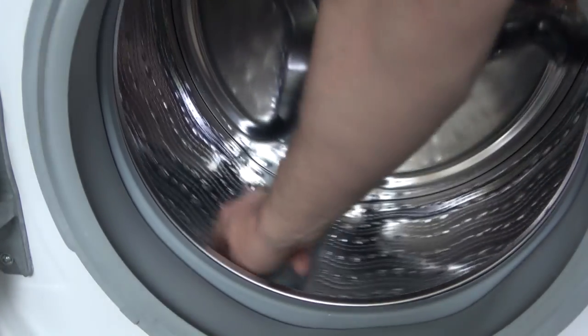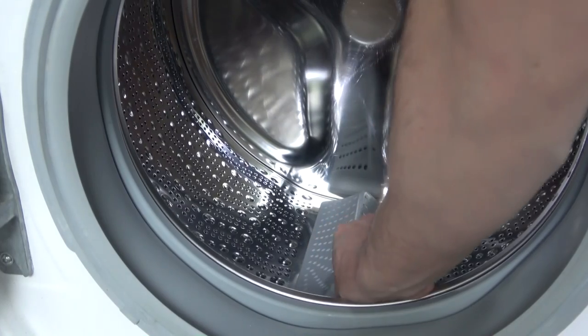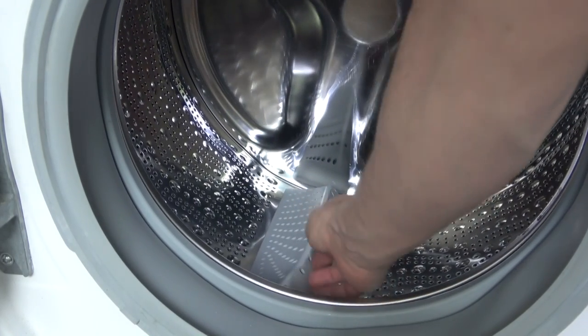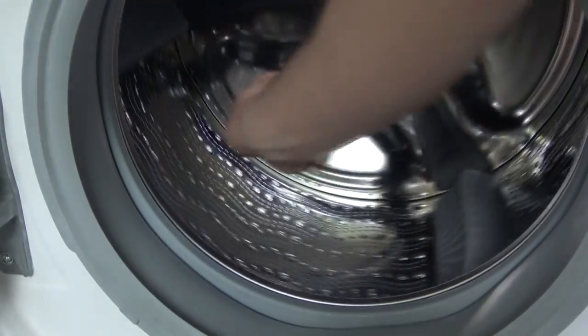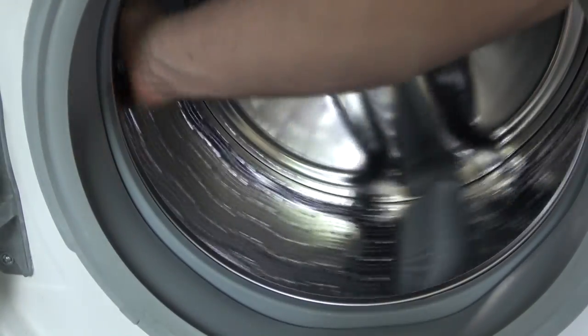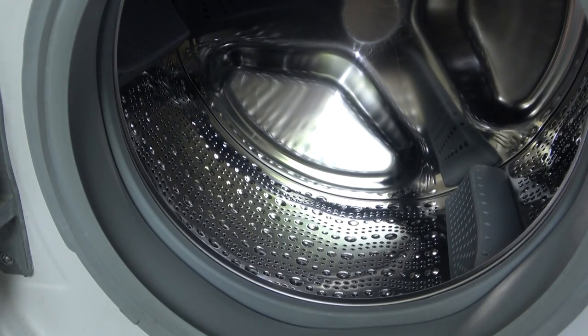We've got these bubbles to help with washing. And we've got these drum paddles, which if you notice, are long. You've got a long slow mount and a short high mount like that. So when it's rotating this way, everything kind of slides off, but when it's going that way, everything's actually lifted and dropped. You get the best of both by not really changing RPM. So the slow roll means you can both soak and be gentle at the same time, whilst the high drop means you can pound and get rid of stains.